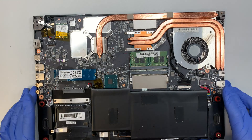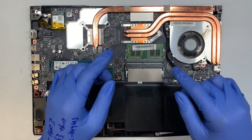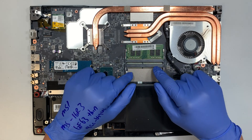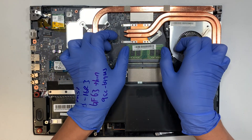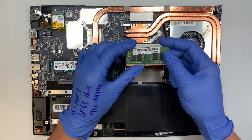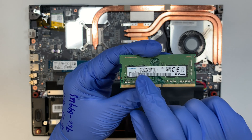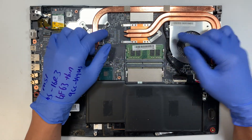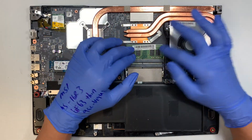Now once you remove the back cover, you can see the entire computer. This is your RAM — right now they only have one RAM installed, so this is the second slot where you can add additional RAM. This runs on DDR4. To remove the RAM, just push the two metal clippers away from each other and the RAM will pop right up. This is PC4, which stands for DDR4 — an 8GB RAM. You can add 8 and 8 for 16GB, or do 16 and 16 for up to 32GB. To install, just slide it in and push it down — the clippers will lock it.